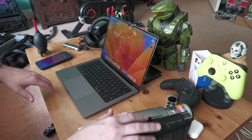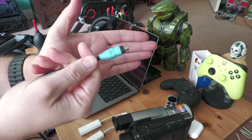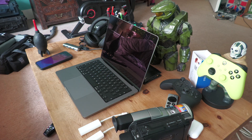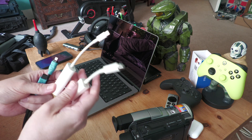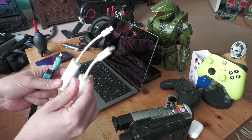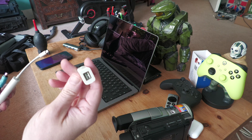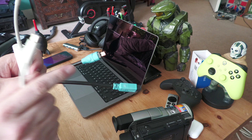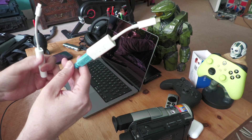Being a modern machine, there is no way for this to connect to the camera directly with one cable. What comes out of this camera is FireWire — the smaller size, called the four-pin. That connection has long since gone from computers. These are the two adapters that Apple sell now. About six years ago, before my previous Mac, you only needed one adapter — the Thunderbolt to FireWire 800 — and with that you could use a FireWire 800 to the smaller four-pin and that was enough.